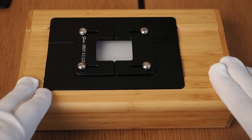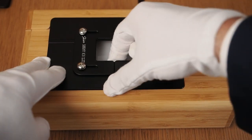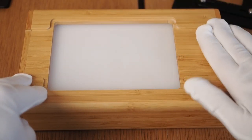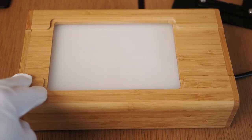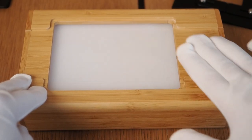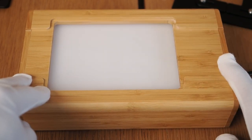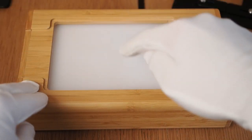The copy box consists of two parts. To reveal the light source, the negative holder has to be removed. Under the piece of acrylic, there is an LED panel which acts as the light source. The acrylic acts as a diffuser, and what I can say right away is that the illumination is very, very even — which is obviously quite important, because otherwise you see lighting differences in the scanned film material.